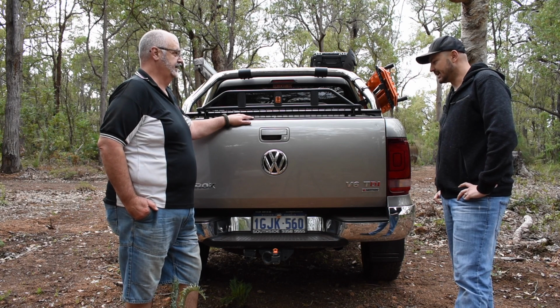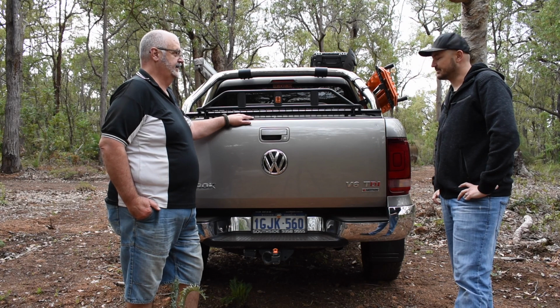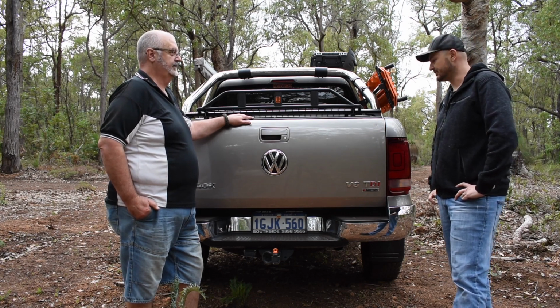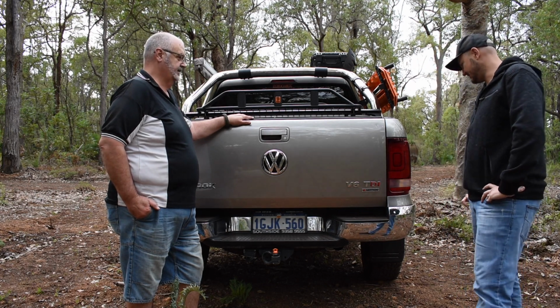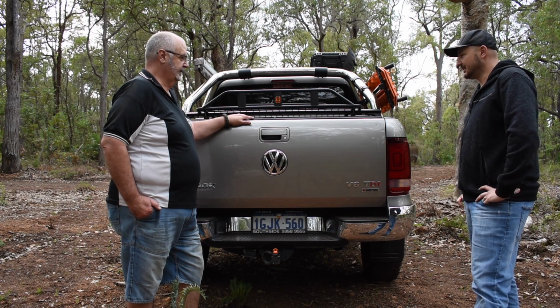It's got a couple of jerry cans on it. But the whole assembly, 50 kilos of spare wheel, 50 kilos of carrier, 40 kilos of juice. It's just a little bit too much weight hanging out over the rear axle. I haven't said goodbye to it completely yet, but I don't run it all the time.